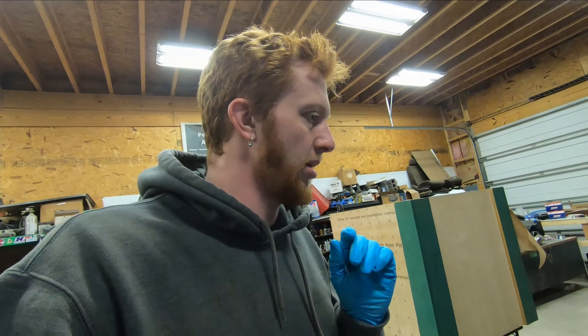Let me go ahead and get it pulled back into the shop here, and do it once over to make sure nothing happened to it. Back in the shop, just giving it a moment to run the fans over everything. Definitely smells like a new turbo system — you can kind of smell any little bit of oil from your hands, fingerprints, stuff like that running off. Everything else appears to be in good working order. I was a little concerned with the oil drain, because as you know, a gravity drain shouldn't have the drain line go back up — but this one certainly does. It's just kind of the way it ended up being for the system. If and when I build more of these manifolds, I'll raise the turbo up a little bit more to alleviate that problem. But it looks like it's perfectly in one piece.